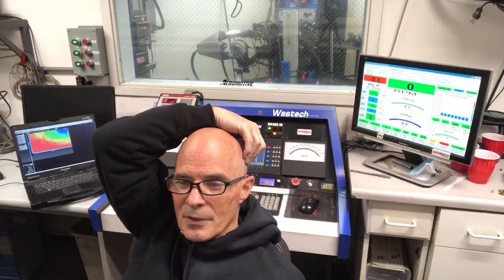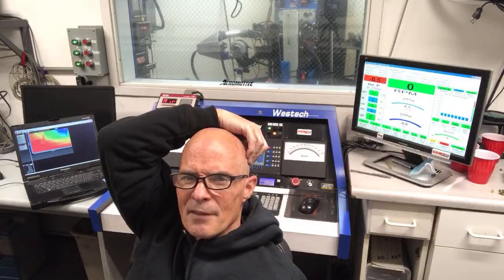We can't make it run on 1 pound because the spring won't go down that low. We are running aftermarket valve springs. Yeah, these are Comp 26918s. We've also run this with the LS3 springs as well. This turbo probably will not make 40 pounds on this motor.